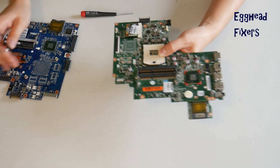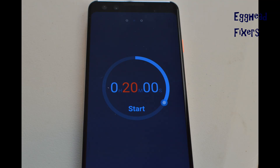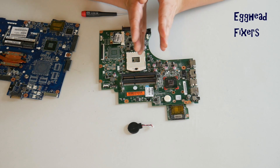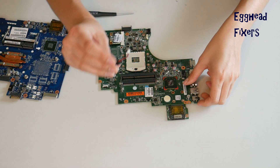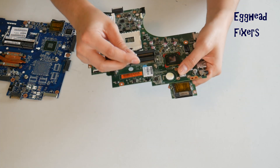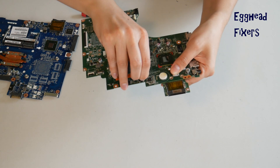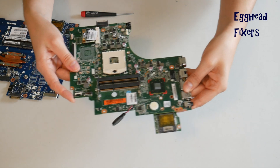Now that you've done that, go ahead and set your CMOS battery and your motherboard aside for 20 minutes. This amount of time will reset the BIOS. Once that time is up, you've done your BIOS reset — it's that simple. This fixes a world of problems, including the ones we mentioned at the beginning of the video. Go ahead and plug it back in gently, just like you removed it, and now BIOS is reset.